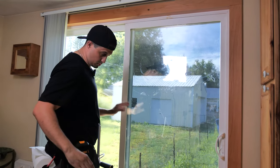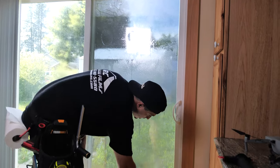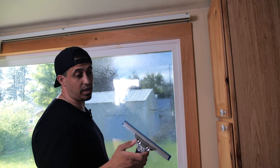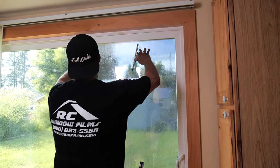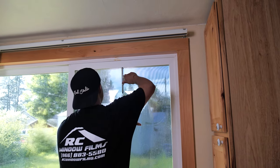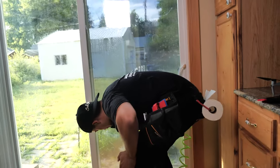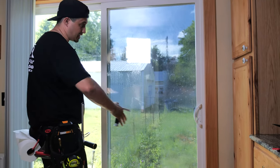I'm going to take my liner, put it at the end, and now I can adjust my film if I need to. Looks pretty well set. On all four edges I've got my film fully tacked down. I'm going to come right here, get it nice and sprayed, and use a flat extruded channel squeegee, which allows for a much harder squeegee, to pull out that water and tack the film into position. Now that it's tacked, I'll come down with firm pressure all the way to the bottom.